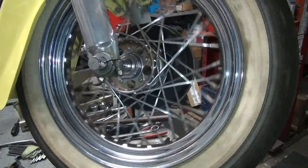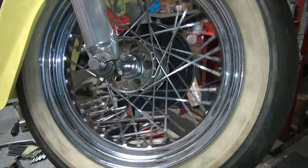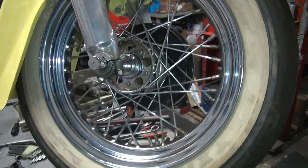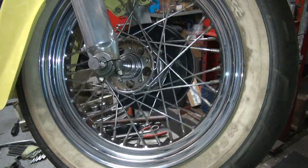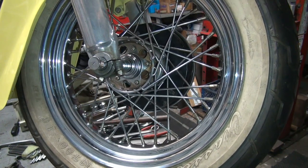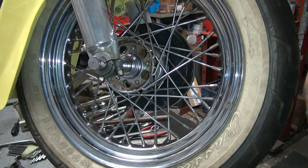So gotta think of something else to do. So I think now what I'm gonna do, I'm gonna put some tape on the springs. See if that might be it. Now the shoes aren't being pulled up, so maybe if I had the cable on there, it would pull up and I could tell what's going on that way. That might work. We're not exactly sure what the dragging is, so it's hard to tell. And I think I'll try the tape method. So we'll come back when I figure it out further. Otherwise, it'd be wasting another hour of video. So we'll see what happens. I'll let you know.